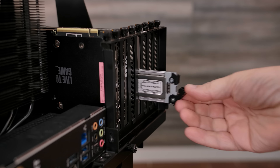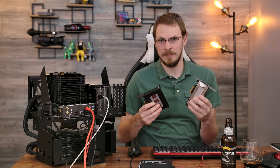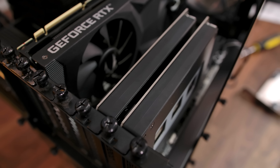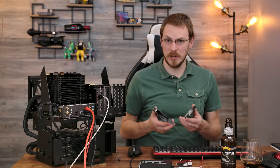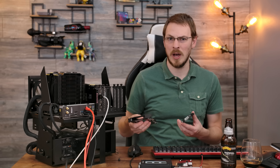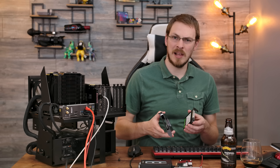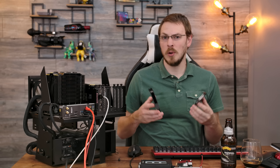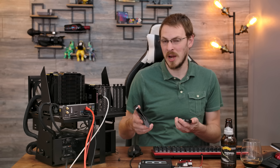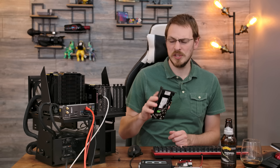So two products from Icy Dock with kind of the same idea in mind, but two very different ways of executing it. What do I think of the Icy Dock 2.5-inch hot swap bay? I really like the idea of using the PCI Express slot as a hot swap bay for a 2.5-inch drive. I could definitely see some circumstances where this would come in handy. I really wish this was a PCI Express 3.0 slot, though, as I feel they're missing the mark — having hot swap but not getting full SATA 3 speeds out of it. There is also a fitment issue: because they're using a PCI Express slot, you're limited to 7-millimeter thick SSDs. If you try to go with a 9-millimeter thick drive, you won't be able to fit it into the hot swap bay.